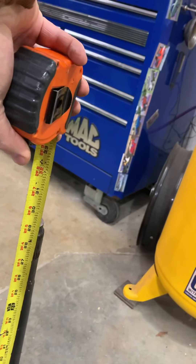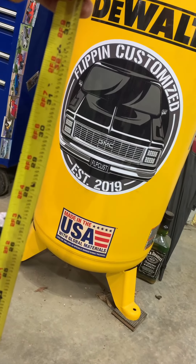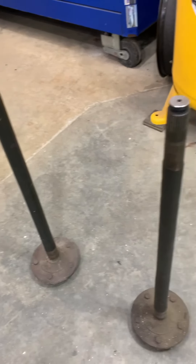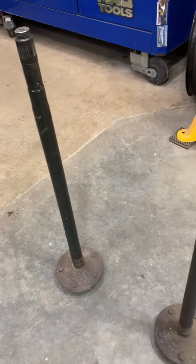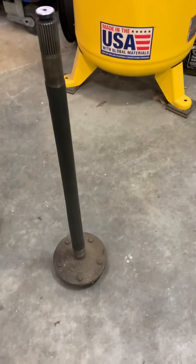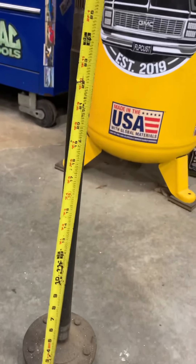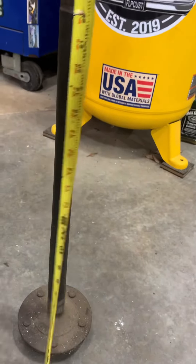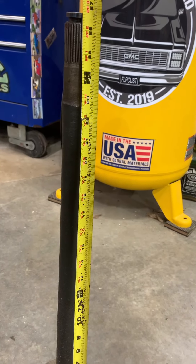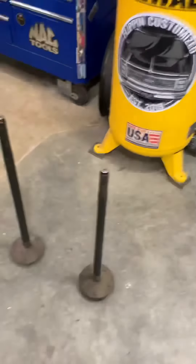The problem is these Blazer axles are too long. We need to maintain our axle length — the ones that came out of this housing are 26.625 inches, or 26 and 5/8. The Blazer ones are 29 inches. Apparently on the late-model Blazers, the rear end is wider due to rear discs. So we need to order 28-spline axles that match the 26.625-inch overall length. To measure length, go from the outside flange where the wheel bolts on to the very end of the axle shaft.